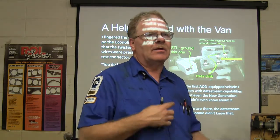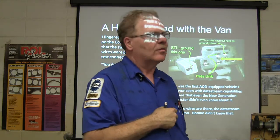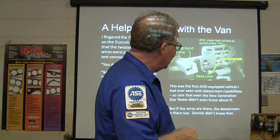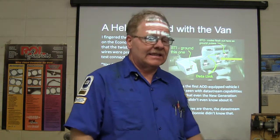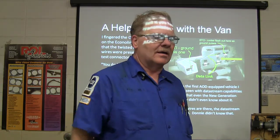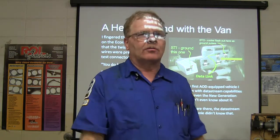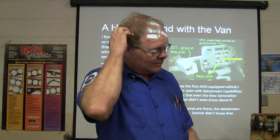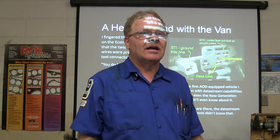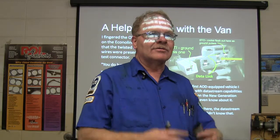I had noticed that when I was over helping him one day when I was off. I said, you've got data stream in this van. He said, well, the scan tool says I don't. And I said, you've got the right model in there and everything? Tell it you've got an E4OD transmission. He said, well, I don't have an E4OD transmission. And I said, well, lie to it. Tell it you've got an E4OD transmission. When he did that, it gave him data stream, and all of a sudden he could see what he was doing.